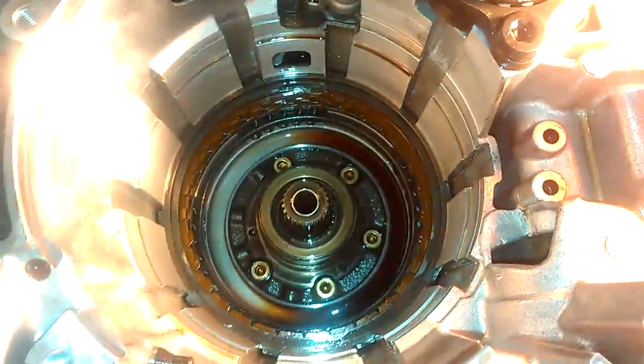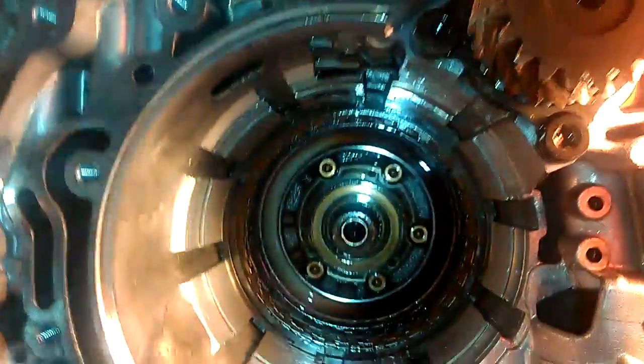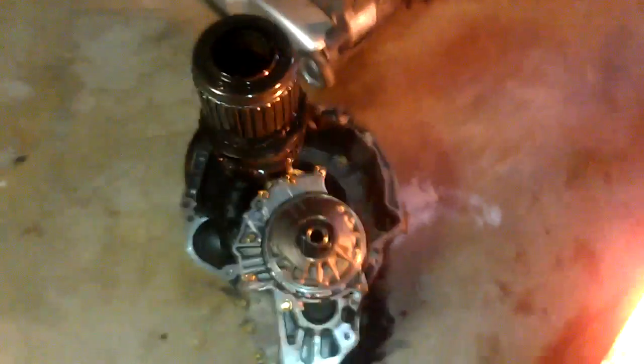And not even in the little magnet that catches debris — the fluid doesn't look contaminated or anything. It makes me wonder what it is. There's the clutches right there, obviously, and here's the other parts of the transmission. See this part right here? There's one part, and there's the clutches in there, but they don't appear bad or anything.